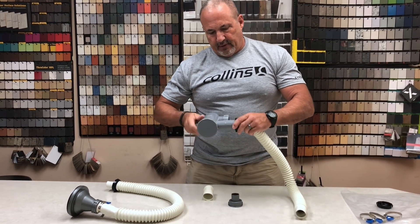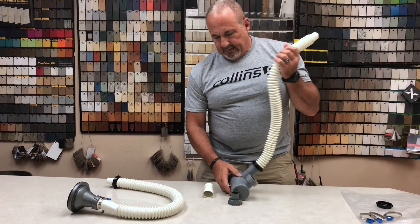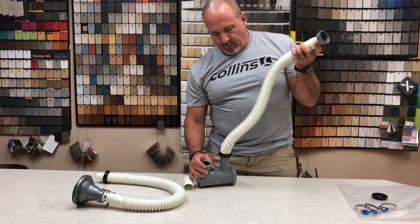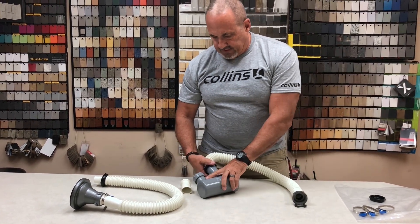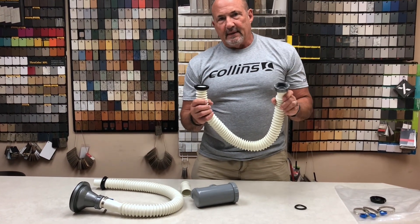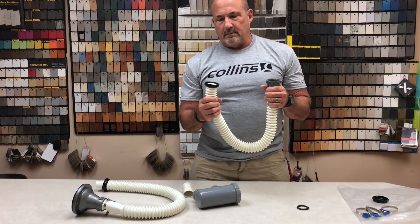I'm kind of cheating by turning the part, but it just has to be snug down hand tight. And of course, this is going to your drain. You can cut it to any length you want — just cut it along the ribs, cut it on the high side of the rib, and then it makes its own natural seal or flare inside this nut. Should be an easy replacement. This is good, soft, and flexible, so this should be a good replacement for the standard gray drain hose.